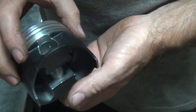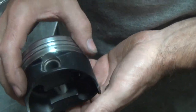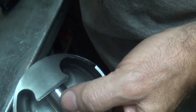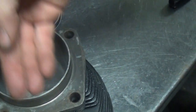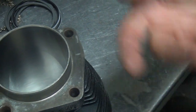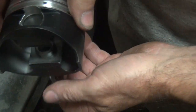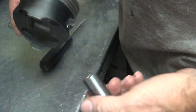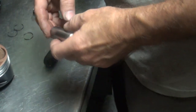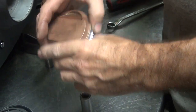Now if you had a flat spiral lock or a circlip style, it's hitting on the side, trying to knock it out. It's hitting on the side like that, and eventually it'll knock this wall right out and the little clip will come out. These ones here, it just jams them in tighter. But if you hit it enough times, it still will screw up the groove and pop it out eventually — it just takes more effort.